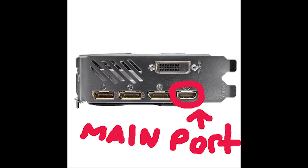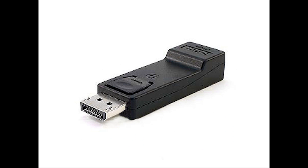HTC doesn't tell you this, but you have to buy a converter if you have only display ports, like I do on my GTX 1070. You can get a cheap one from Monoprice for $4 — I'll throw a link in the description. That's basically the only way you'll be able to have a second monitor displaying if you want other people to watch you; otherwise you're just going to have your display in the goggles only. So once again: HDMI from the link box into the main port on your graphics card. Hope this helped — leave a like, thanks, peace.